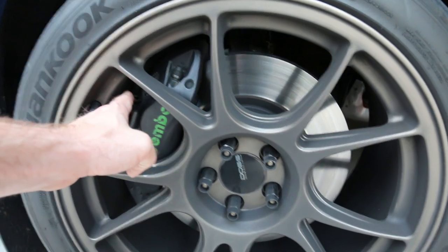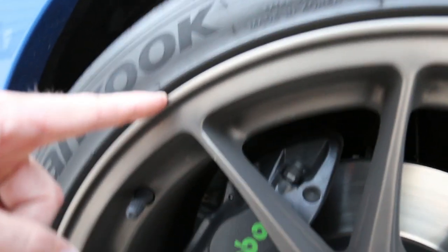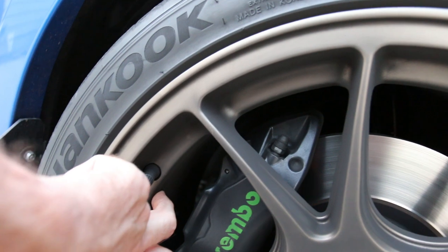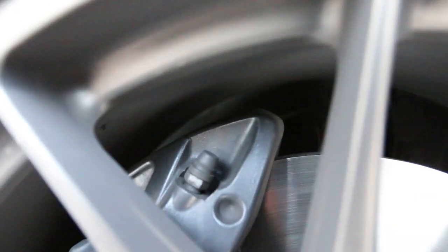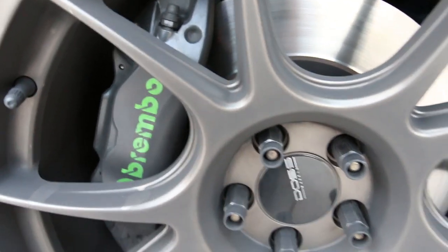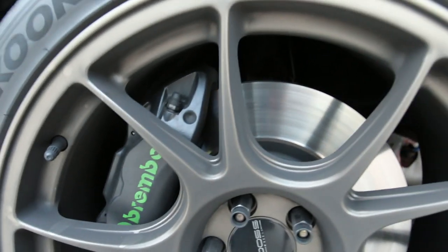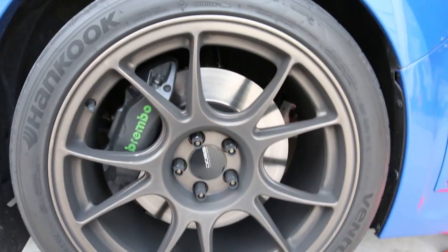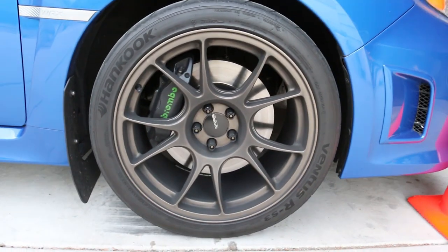Different wheels have different inside diameters for the barrel. Even though these are 18 inch wheels on the outside, depending on the wheel and how it's made, the inside diameter of the barrel may be a little bit higher up or stick a little bit lower down, so you may run into different clearance issues. This is what it looks like on an 18 by 9.5 — these are the DOS FF2 wheels and they clear with absolutely no issues whatsoever. I have a lot of space on the inside to clear the caliper. On the stock 17s, it was fairly close and my main issue was the barrel of the inside of the wheel hit up top. It's really wheel to wheel — you can try it out or see if anybody else has used a different wheel. But from what I've seen, 18s just makes it easy and they look great.